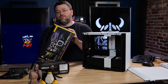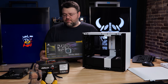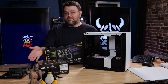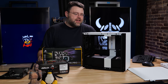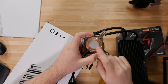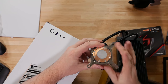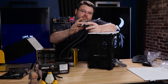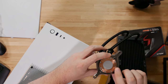For CPU cooling I'm using the massive overkill H115i. If you're getting a 3700X, maybe even a 3800X, the box cooler is fine — it's not going to be fine on this motherboard because it doesn't have AMD style mounting. The H115i Pro is a little chunky on either end. I'm going to hypothesize that the pre-installed thermal paste is not sufficient for the triple chiplet design on Ryzen — that's just my guess, but I'm probably not wrong.